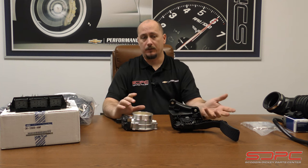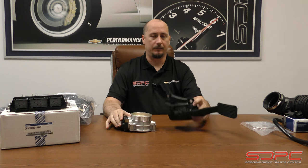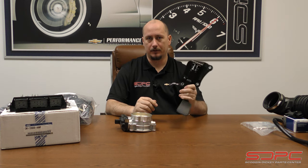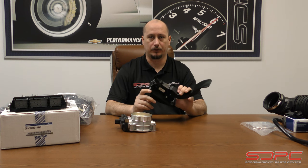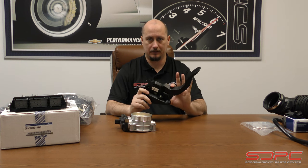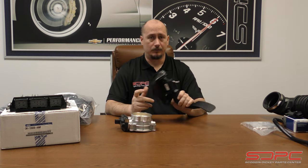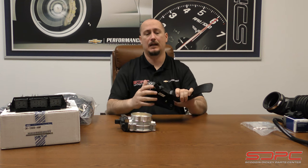We've seen it happen before, especially with drive-by-wire swaps in other vehicles — you go to put a throttle body in from one vehicle, you've got a pedal from another one just because it seems like it will work. Then you go to fire it up and you're not picking up your pedal, or you have intermittent throttle. You can drive around or cruise, go wide open throttle, and then you get dead pedal and go into limp mode — sometimes cruising on the street, or unfortunately sometimes at the track.